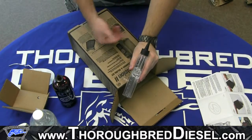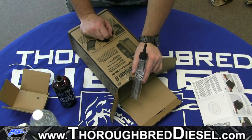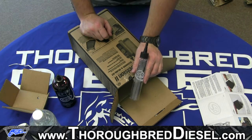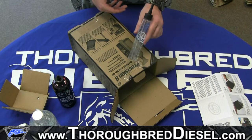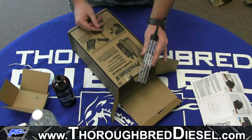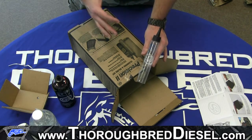Each tick mark represents 2.5 grams of oil. To know exactly how much oil you'll need, you'll want to log on to www.sbfilters.com — we'll throw up a link to their website now. You'll enter in your kit part number, go under the detail section, and find out exactly how many grams of oil your particular filter needs, whether it be a drop-in filter or cold air intake.